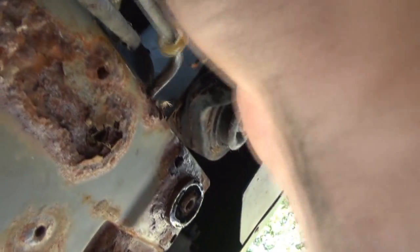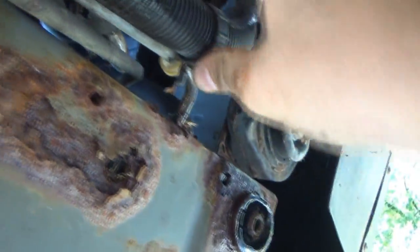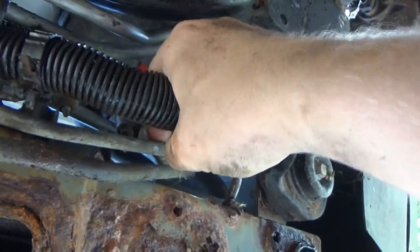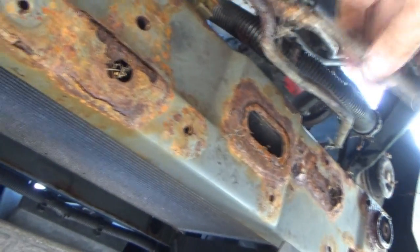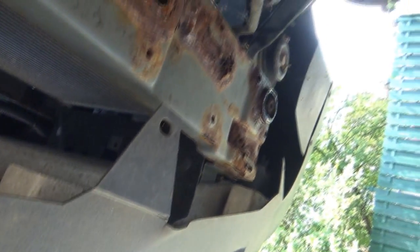I had to pry this hose from the body — hopefully I'll be able to get them back where they go. There are two clips here, one on each side; I just pried it right out. With how rusty this is, I doubt I'll be able to get them back in, but it's probably going to be the only way to get the lines through. This one has the weird curve on it — and one is out. This one goes straight up — it's going behind all these other harnesses, wires, or hoses. And there we go — both lines are out.